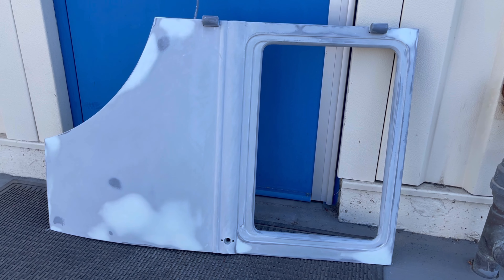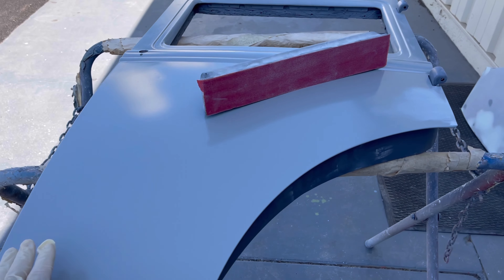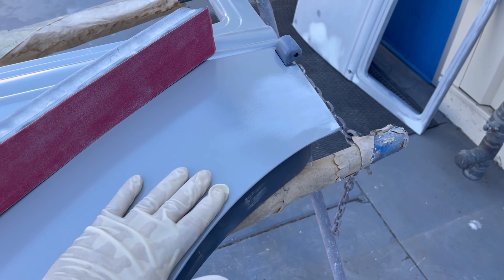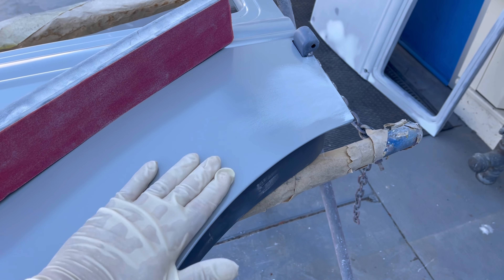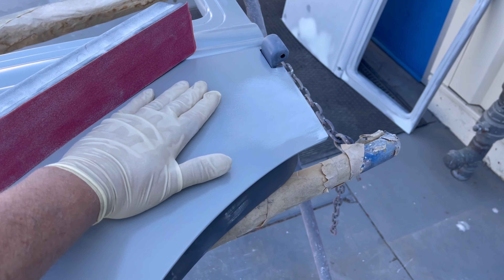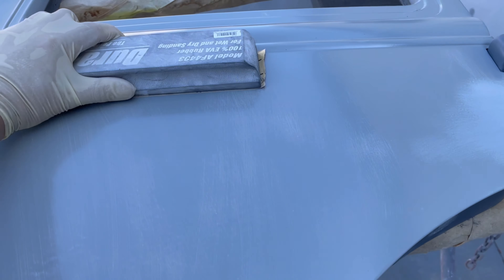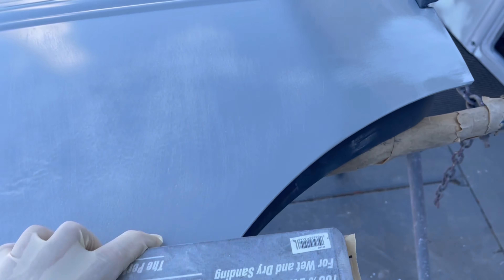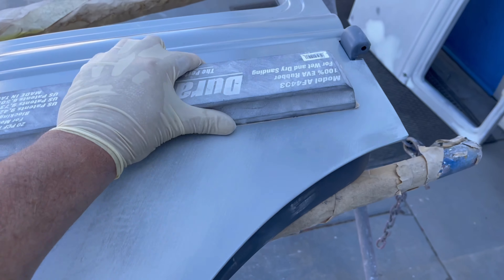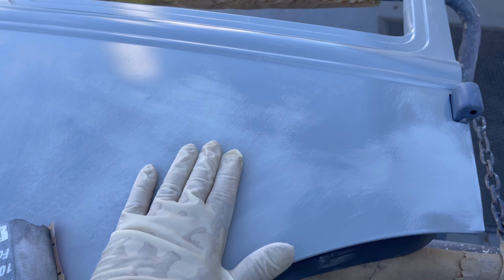Here is the driver's side rear door. Overall it's a very smooth panel — maybe a little buckle, a little bit of something going on right here that we'll have to sort out. It's a little high through here. I honestly can't remember if I did any bodywork on this or not, but we'll roll the block up and down, crisscrossing across the panel, looking for the high spots and the low spots. You can already see that high right through here — we'll see if we can work that out. I'll block this with 150 and I'll come back.